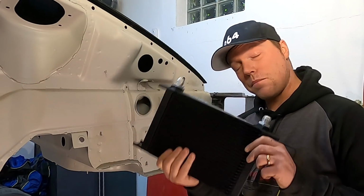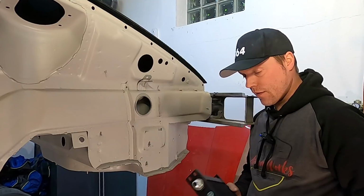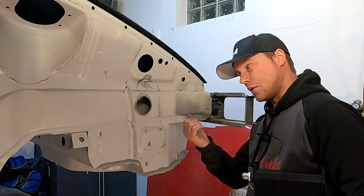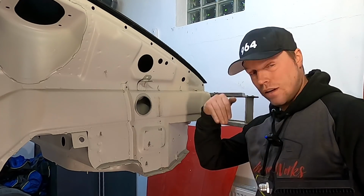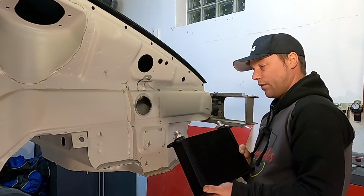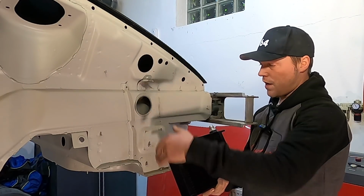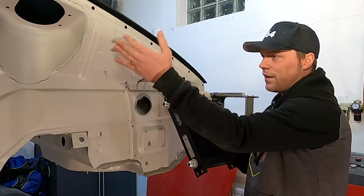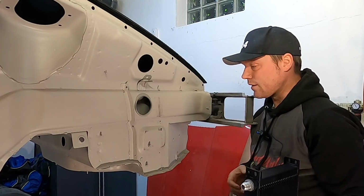Okay, so now that I'm potentially going a completely different route, it means that I am not in any way at all bound to any of the preconditions I had previously. Literally, what I'm bound to is the geometry here, and I would like to use the mounting points on this side, which looks similar on the other side, and somehow build a concept that really channels the air in through here, and then does not take it down. I want to go somewhere in that direction, right? So I saw a brilliant concept from one of the fellow enthusiasts online that put up coolers in this manner. That was much larger coolers. That was really nice. I'm thinking maybe I should put the cooler in this manner and then get the oil in through the lower one, of course, and then out through the upper one, and do an exactly same setup on the other side.